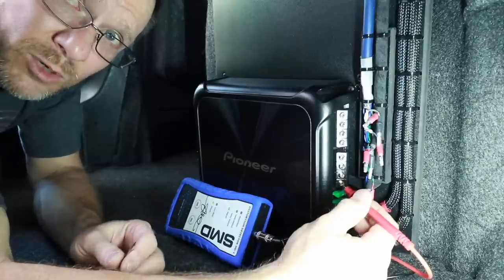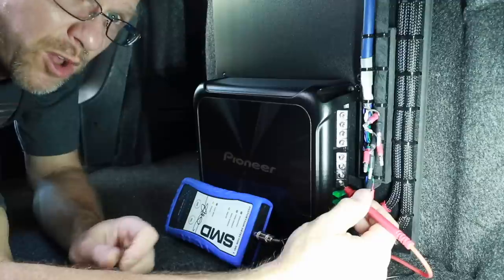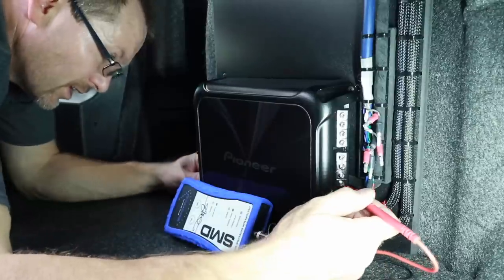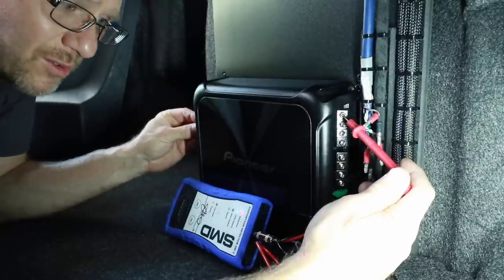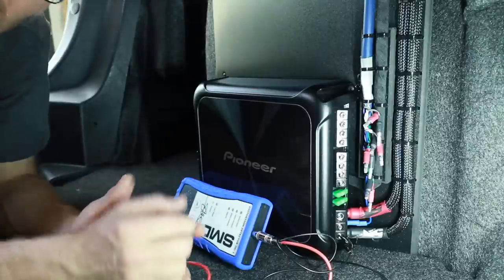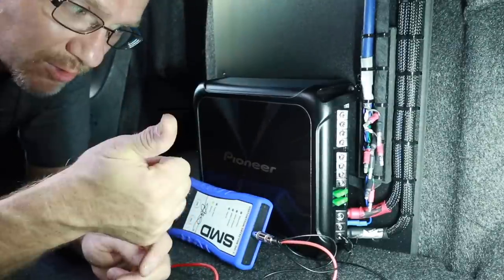So we'll go ahead and relay that information to the customer so that they know when they're adjusting it. Go ahead and play negative 5 dB and leave it at 43. Since we're attached to the rear, we'll do those first. So we get a red light there. It's telling us that we're clipping. We'll turn it down until the red light goes off. The gain structure is set on the amplifier. At this point, what you want to do is go ahead and turn the radio down.